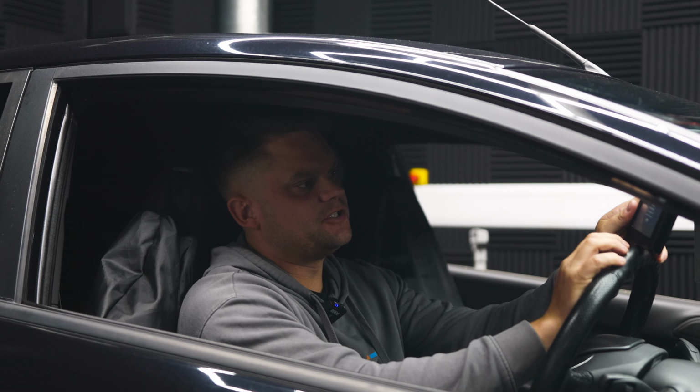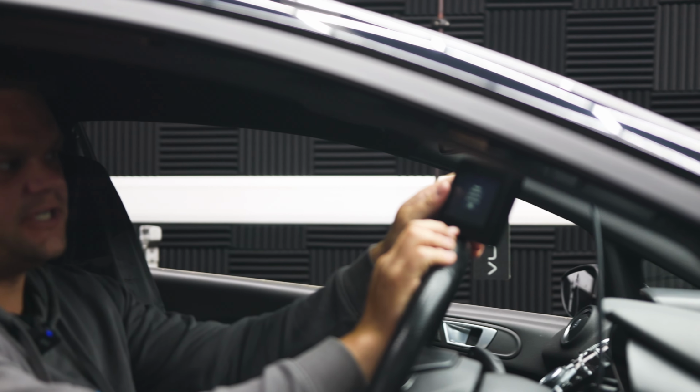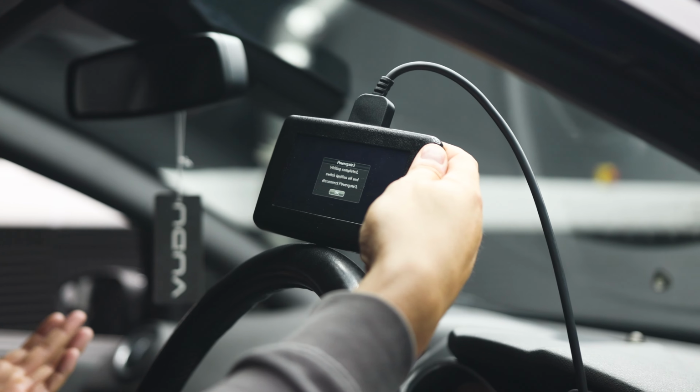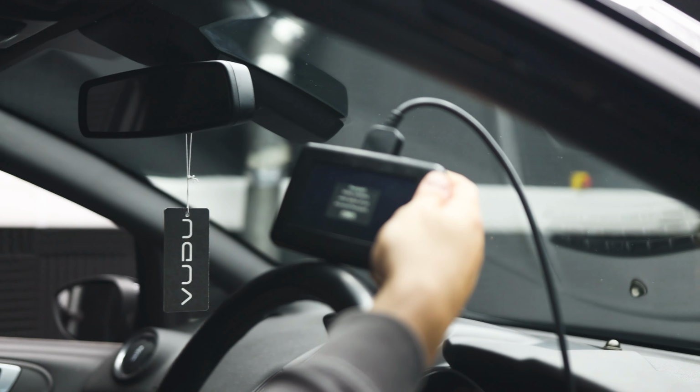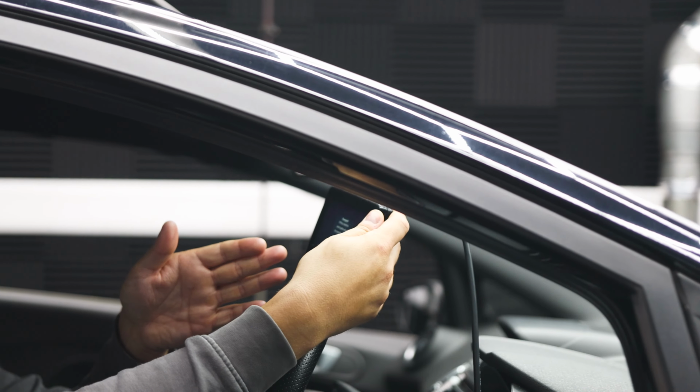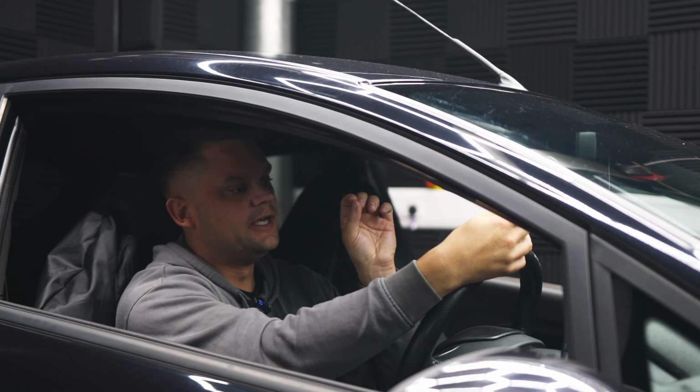Okay, so as you can see by the screen here, the writing is completed successfully and it's telling me to switch the ignition off and disconnect the power gate. So at this point, follow the instructions. When you come to start the car, make sure that there's no engine light on. If there is, you can use this tool to do the diagnostics.